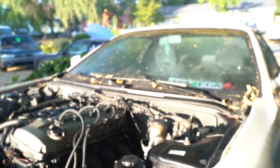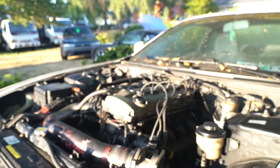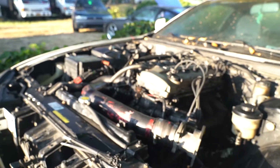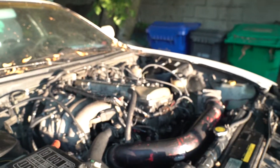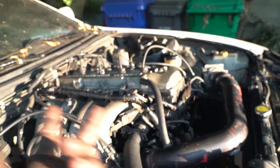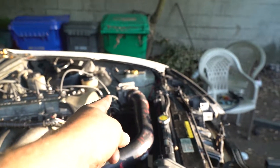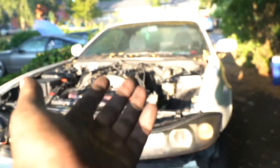The bolt is mounted a bit differently — that head might also be an S13 dual cam, I'm not sure. The only difference it makes is the intake and the mass airflow sensor; those are the two things that will stop it from running in an S14. If you have an S14 intake and an S14 mass airflow sensor, you're set — at least that's the research I did.